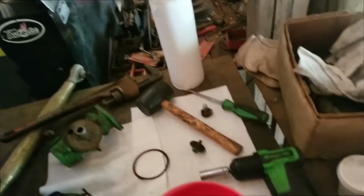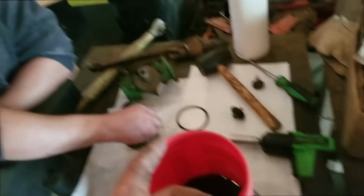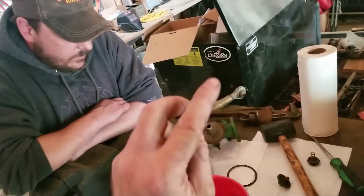Now, one of the guys in the comments wrote me that these John Deere Bs had a really bad problem with fuel overflowing into the engine, to the point where supposedly John Deere came out with a shutoff that you put in line, and whenever you turn off, it shuts the fuel off automatically. I didn't research that. I don't know if you guys know what the guy's talking about and have a link for it.